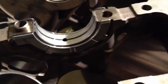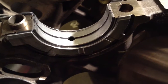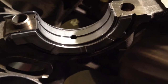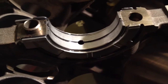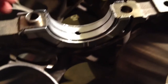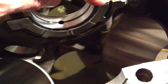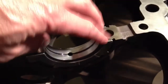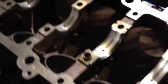I've also installed the thrust washers — one on each side. The thrust washers need to be lubed with assembly lube as well. There's a surface on the crank which we'll look at later that runs in close proximity, so you want those to be lubricated for startup. The thrust washers will ultimately be captured and kept from rotating once the bed plate is placed on there.